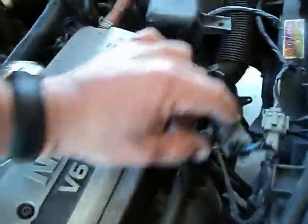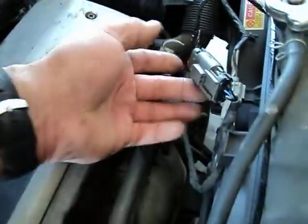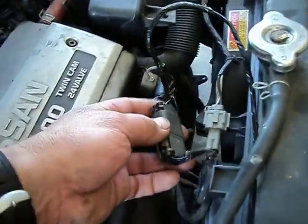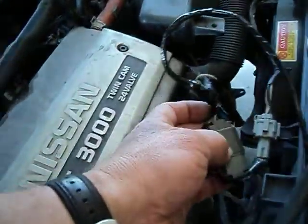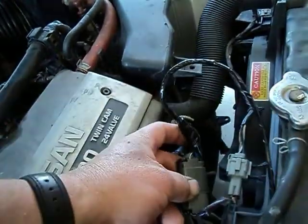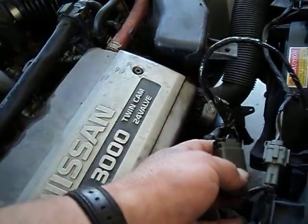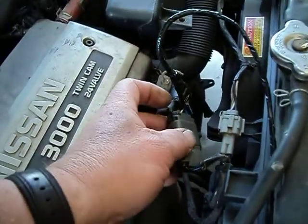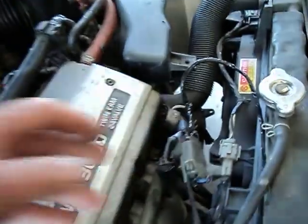This connector here is the one for the front oxygen sensor — it comes up this way. So we just tapped into the blue wire. The yellow wire here is for the power and I tied it into the existing power wire for the heater circuit, and it's switched. Then I cut into the center wire, which is the sensor wire, and that's what's powering the EPI.